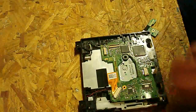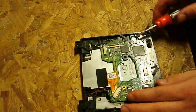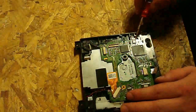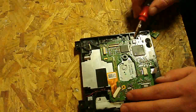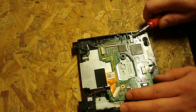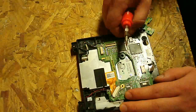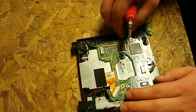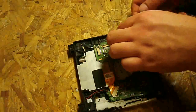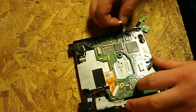Just be careful. We're going to put a flathead screwdriver bit in and work this out a little bit as we go. It's clipped down here, so you can unclip it underneath, which gives you even more room. That makes it a lot easier to pop it out. Now we've got a lot more ribbon exposed, and it'll be easy to just pop that ribbon out.